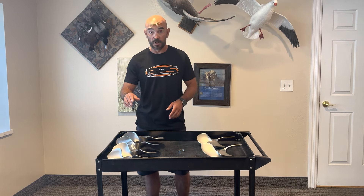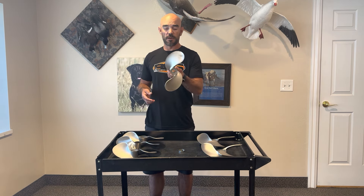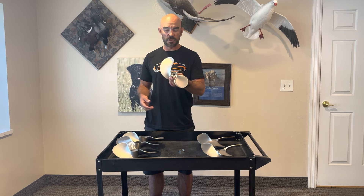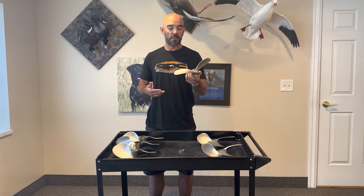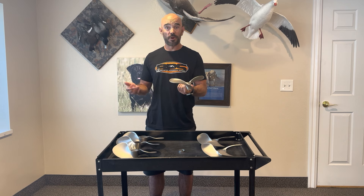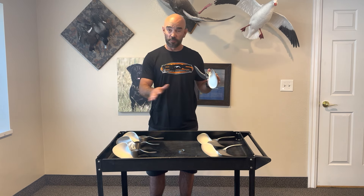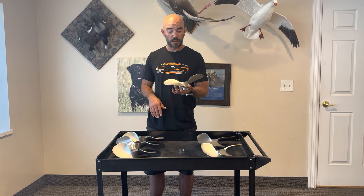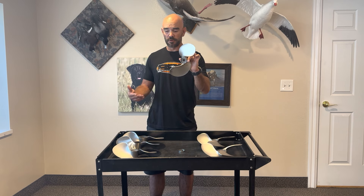Two blades are what I usually have on my boat. I'll start with the smallest horsepower, smallest size model — that's our 11 by 10. You'll find these on a Mud Buddy 23, either the minis or the sports HDRs. These fit great on 23s or the color 25s, and they'll fit on a bunch of different manufacturers: Mud Buddy, Gator Tail, some Copper Heads. These are all three-quarter hex props. This is a very good prop for the smaller horsepower motors — 23s and 25s.